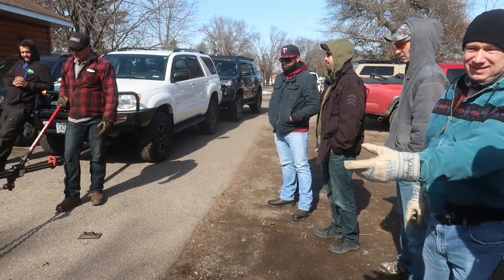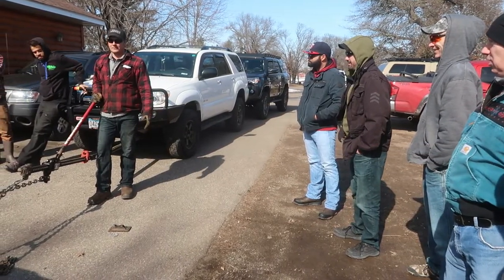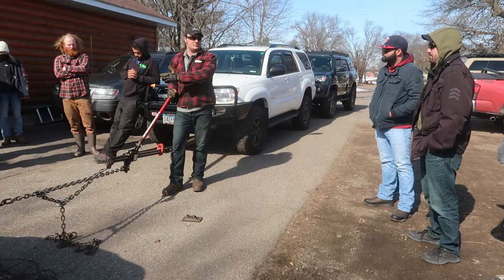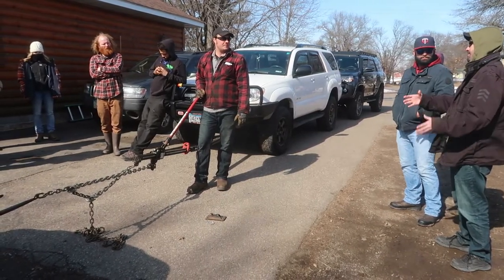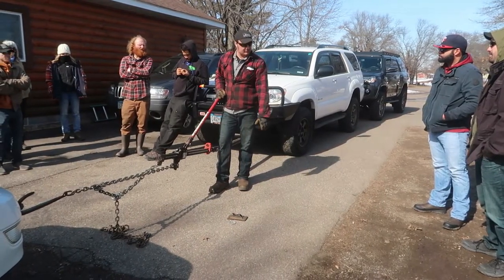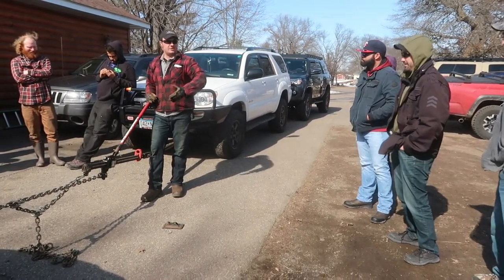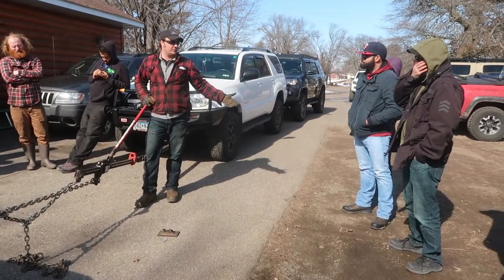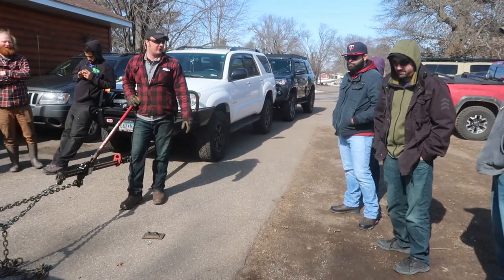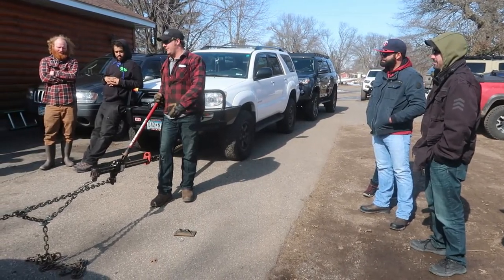Yeah, no, I like it. Like I say, if you ever use one to change a tire, it's worthwhile to spend 5 minutes and go find something, anything to put underneath, or your spare if you don't have to use your spare. I wouldn't even take the wheel off until I got something underneath there. Because once the wheel's off, if that thing drops, you're in trouble. Say you're taking your wheel off because you got a rock jammed in the caliper or something. Yeah, your buddy's spare. Like I say, anything, a rock, a branch, somebody on a trail ride you don't like.